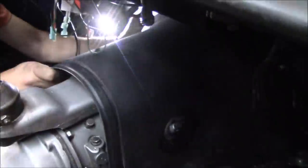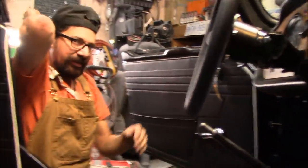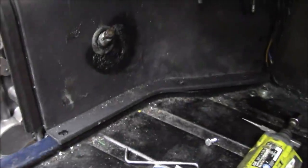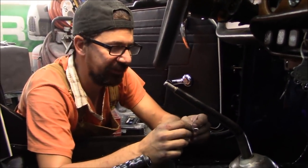We probably never heard Alin swear on any of his videos, so if you've ever had the joy of putting one of these transmission tunnel covers in, you probably learned some new Bulgarian. Anyway, we've got the half cover — but it's still a challenge to get those bulkhead bolts in. He's been fighting with the one on the driver's side. Finally got that one in, so we've got the other three across the top end. We're going to start working on the floor ones. I know from the Clark and Clark two-piece cover directions that you're supposed to start the bolts on the floor first and then work on the bulkhead ones, but we actually started the bulkhead ones first and then going back to the floor ones, hoping that works out. Yeah, it's a struggle.